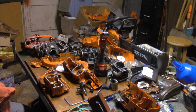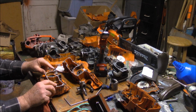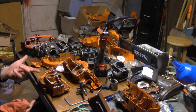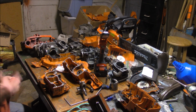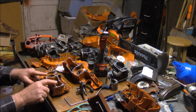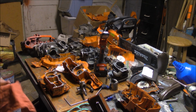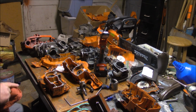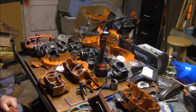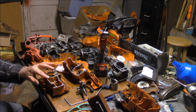In those cases where I had put in the steel cage bearing, I also put in steel locating pins, without thinking about it. I just put steel in every time. And it's possible that the plastic locating pins were a third issue. So when I put in the steel cage bearings and the steel locating pins, and glued them all together, and set them up running 12.8, 12.9, those saws never failed. They lasted for years and years, a lot longer than the way they came from the factory. Then all of a sudden they stopped coming, and the dealer stopped having problems with them, which is because Husky had solved the problem, whatever it was.